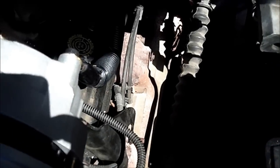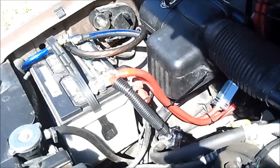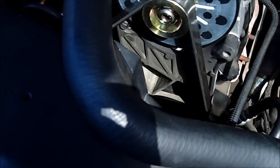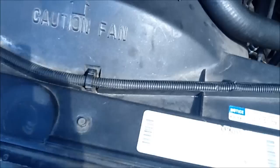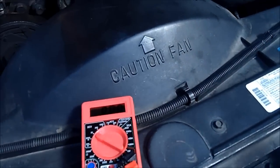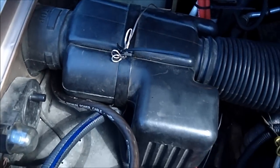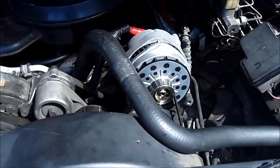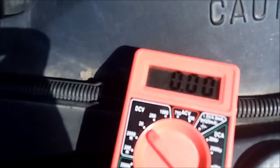I've got zero gauge negative going around to the battery and zero gauge positive along with the factory positive from the alternator, just to be extra safe. I have the voltmeter out right now — I disconnected the voltmeter wire because in reality it was too thin, so I was replacing it and just cut it while putting all the wires back on. Going to use that to get the voltage reading. Right now the probes aren't connected, but I'm going to go ahead and start the truck. Remember it was sitting at 13.8–13.9 earlier in this video.